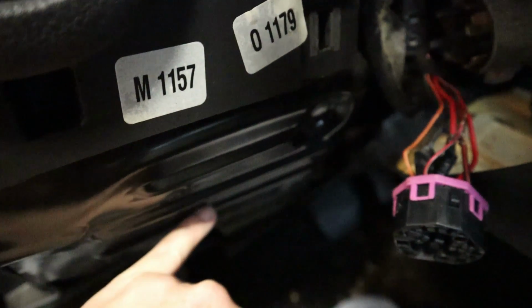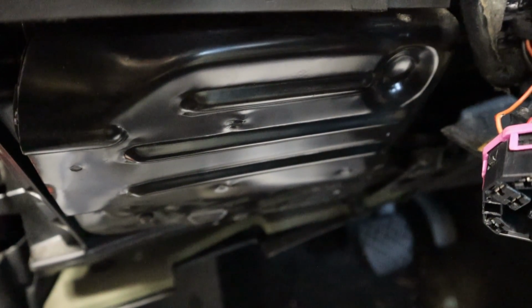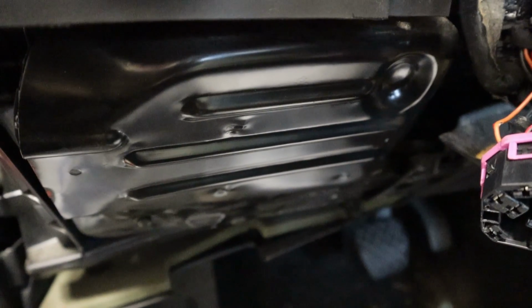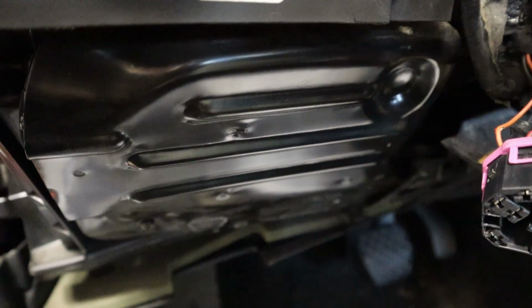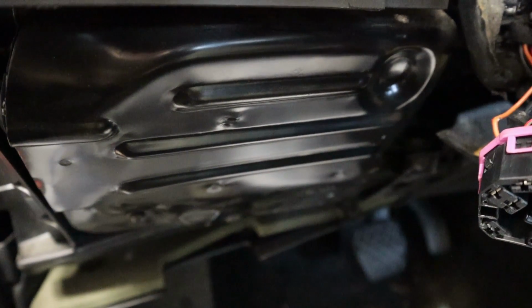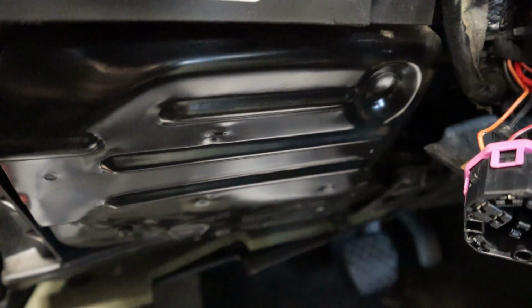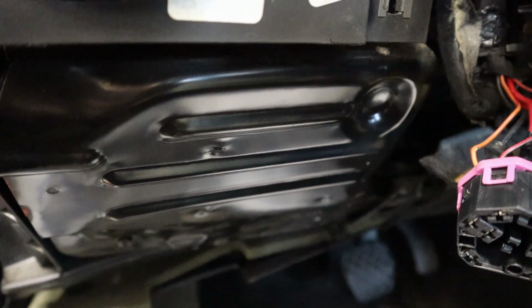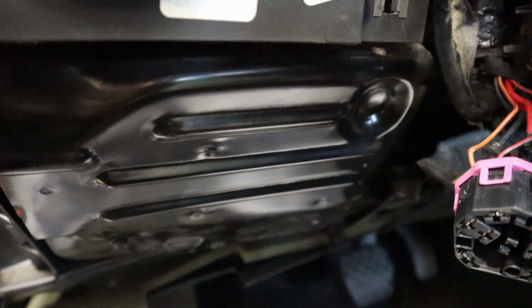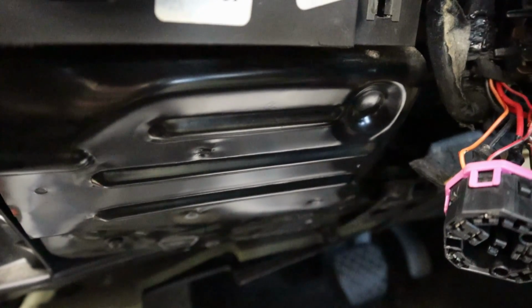So we need to make sure that all of our pins on our relay, if we follow that wiring diagram, are getting the proper powers and grounds and passing voltage through to get to the starter solenoid. So if that relay is bad, you can cross it out by taking the two fat wires and jumping them and trying to crank up the car and seeing if it will crank. You just need to make sure that you're in park or neutral. And also you can do the same thing if you have a clutch, a 5-speed or a 6-speed.